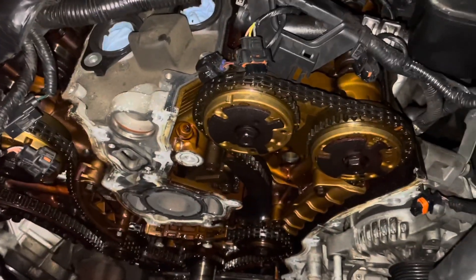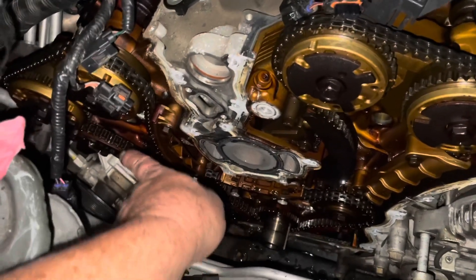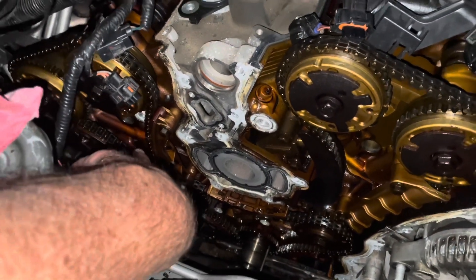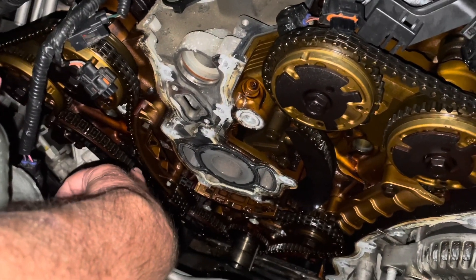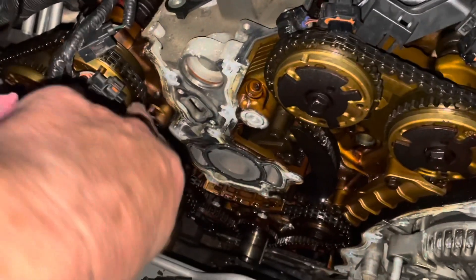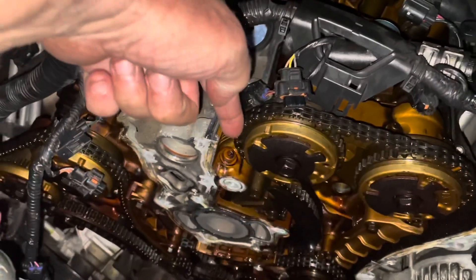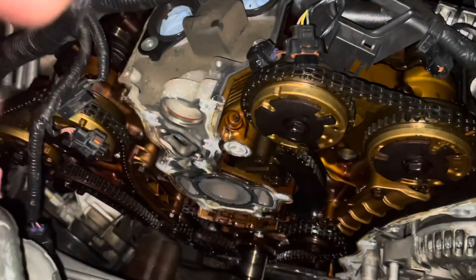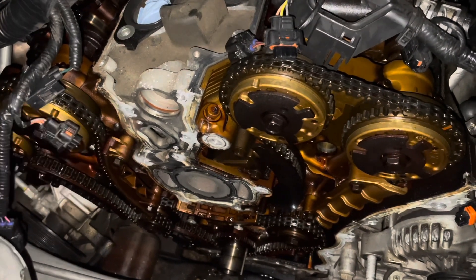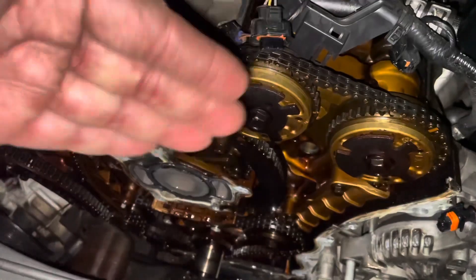The timing cover is now off and it was a bear. There were actually four bolts that got me — a huge bolt in this area, one right below it with a 13mm head, and then two 10mm bolts in the front. I thought those front two were just holding something on the front, but they're actually bolting to the block. Once I got those clear, I used a screwdriver, wedged it in here against the head of that bolt, pried out and cracked it loose. On about the fourth try it finally popped loose. I had to twist it this way, then angle it back that way to get it to come out. So it wasn't easy, but the timing chain is now exposed.